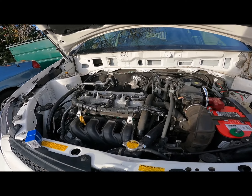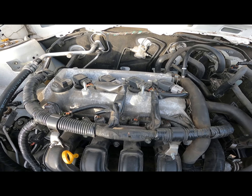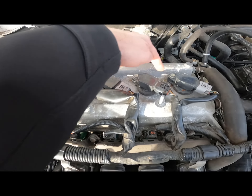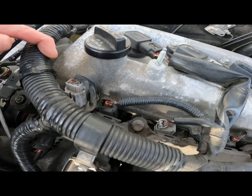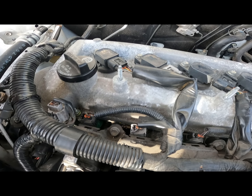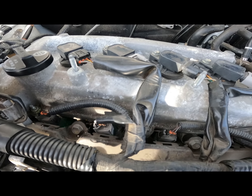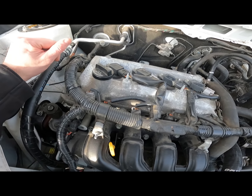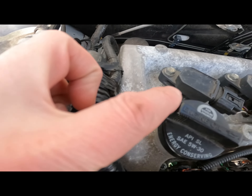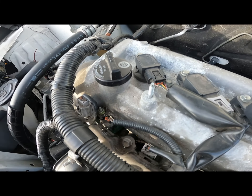It's almost ready — a few more things and we're almost there. One thing I discovered is that, as I've noticed over the years with this car, water gets down in here and just sits and corrodes the aluminum. The other day when it was wet I saw something interesting — it looked like milk drops all over it, which was just the corrosion from the aluminum. That water ends up sitting in the back corner, seeping down in here under things, and it causes a misfire on cylinder one.